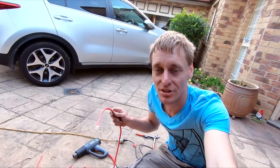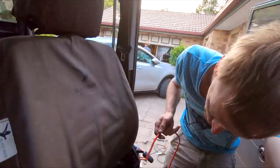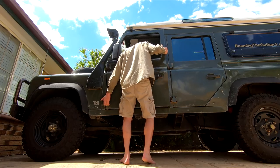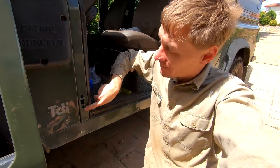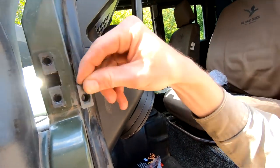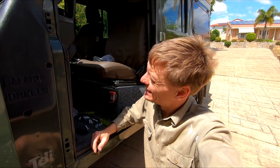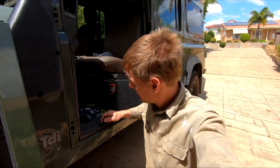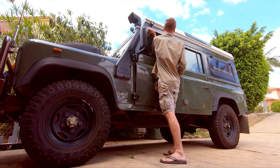I've been making up new cables for where the circuit breakers now are — some nice 6 B&S cable with crimped-on connectors, so it should all fit together nicely. Just waiting for the last few wires to arrive in the mail. For those interested, the door is held on by captive nuts that clip into holes, and the bolt threads into that and clamps it onto the A-pillar — very basic. I had a quick look inside and luckily there's no rust; everything looks structurally sound. I'll put on the last couple of captive nuts, bolt up the new hinges, position the door, align everything, and tighten it all up.